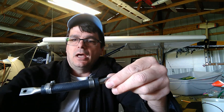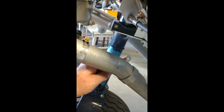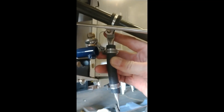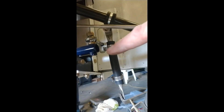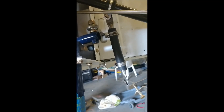I have the support that goes around the tailpipe, and coming up here a cable clamp that goes up to the engine mount. Doing a quick trial — temping it through there — man, that's not too bad. Looks like it's going to work just fine and gives me all the vibration absorption and movement I need. I'm going to rotate the tube so the clamp is away from the nose gear — it would clear, but I want to give myself a little extra room.